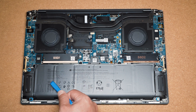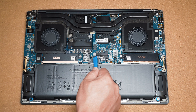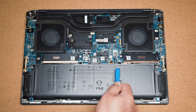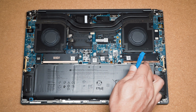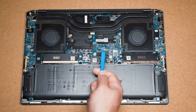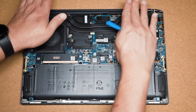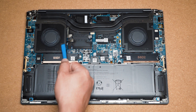Looking at the internals: the 99.5Wh six-cell battery is here with the battery connector secured by two screws. On the right-hand side is the Bluetooth/Wi-Fi module. There are two M.2 slots in 2280 format. As the memory is soldered onboard, there are no RAM upgrade slots. There is a dual-fan and dual-heat-pipe thermal system, with air drawn inward and exhausted directly out the back. One fan is dedicated more to the CPU and the other more to the GPU.